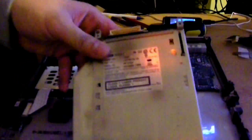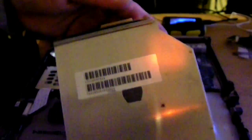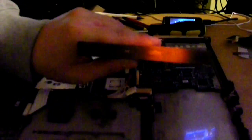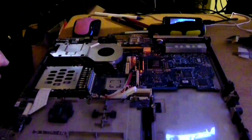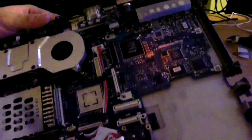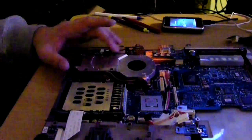The CD-ROM drive. This looks like it uses a slightly different connector than what I have encountered previously. Had this computer still worked, I would have had a difficult time finding a suitable upgrade to even a DVD-ROM drive, let alone a DVD-RW burner. I am fairly certain this is a CD-ROM drive. Had it been DVD-ROM, this laptop would have had an RCA connector for composite video as an additional video output for playing back DVDs on a television — composite, not S-video — again indicating the age of this machine.